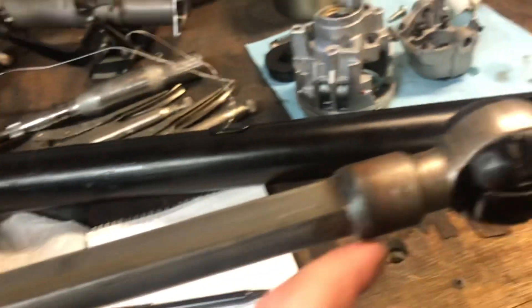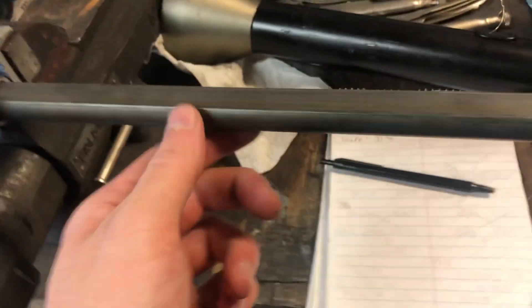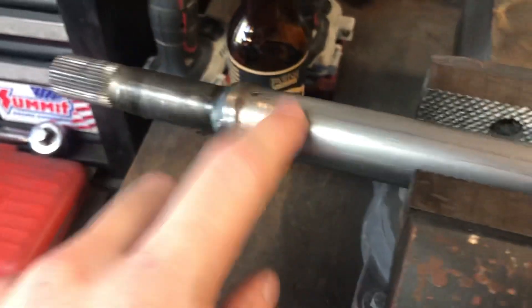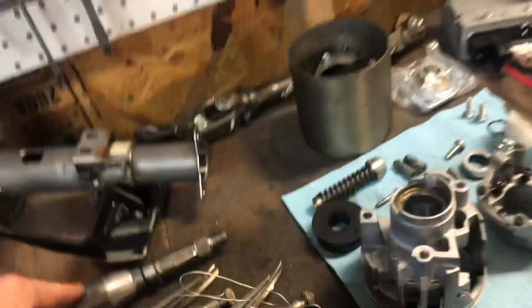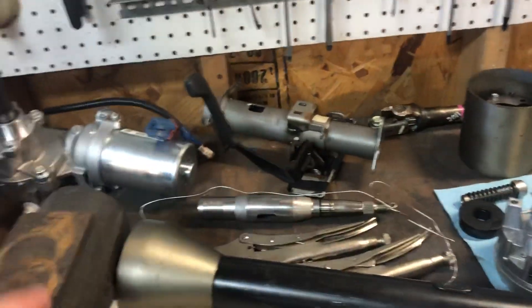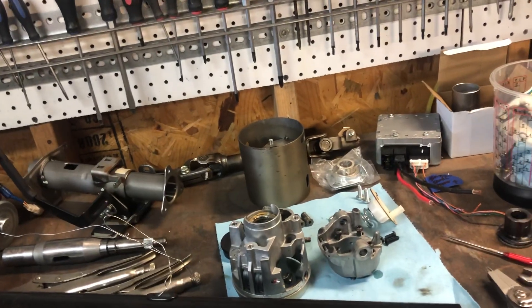This end spline was welded on by the I Did It folks — it's double-D rod welded onto this U-joint down here. It's got some play because it's sleeved in. I'll probably knock it out and take my length from this double-D rod directly, hoping it'll still allow enough room to collapse. I might also need to cut this end off and weld it onto the new shaft — I'm not sure yet if I can work with the lower half or just feed the double-D straight in.